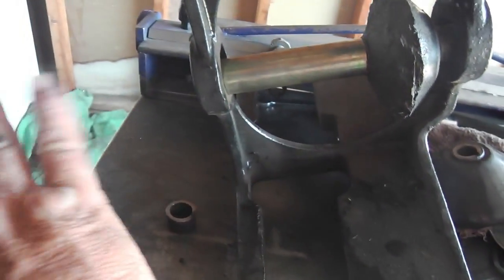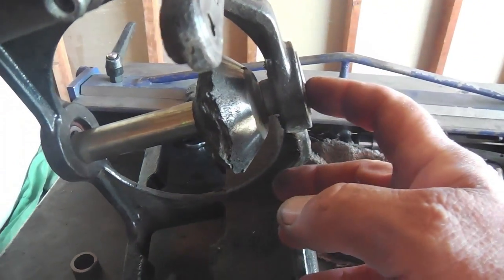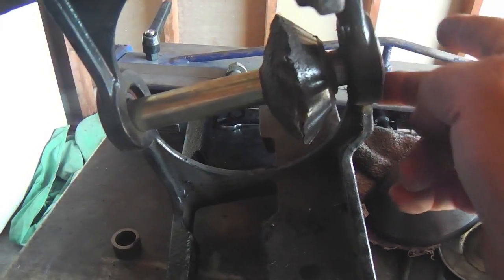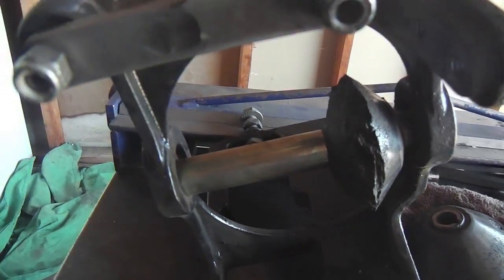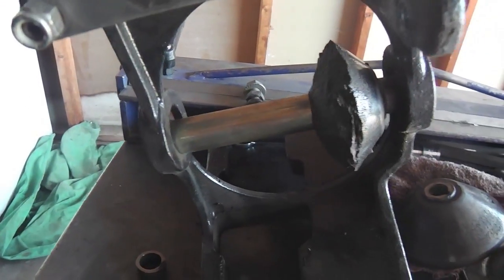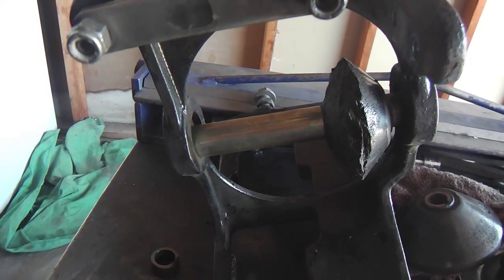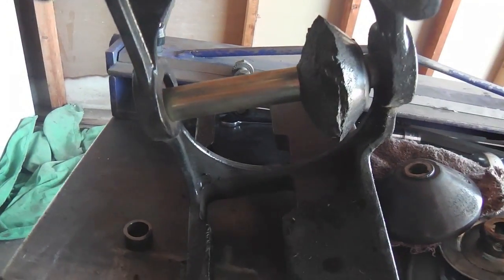When you put in the shaft, you can start to slip these on, but you will undoubtedly want to press in the bearing all the way, or it can be set out a little bit and then just tap it in the rest of the way. Either side, it doesn't matter. I don't recall what the literature says. I think it even says go ahead and press the bearings in and then put the shaft and everything else. But believe me, that's not a good idea. It's better to press in one, at least the rest of the way.